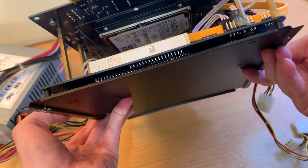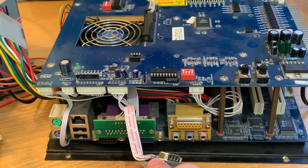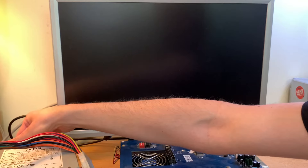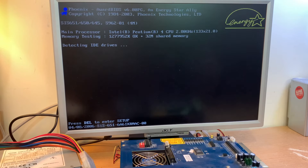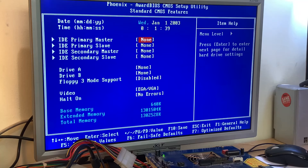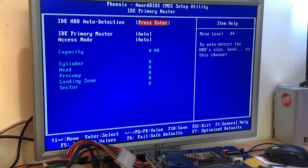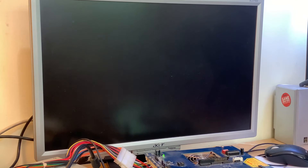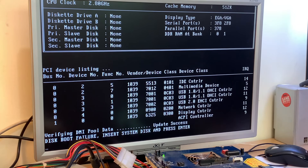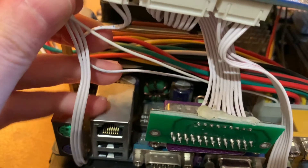To test it I should be able to just plug it into a regular ATX power supply and remove these little adapters so I can plug it into a monitor as well. It's a Pentium 4 — let's check out the CMOS. Yeah, drives aren't showing. It's set to auto but not really detecting. Let's reboot and see if it goes through. Seems to be something up with the hard drive, or maybe the top board is somehow interfering with the bottom board.